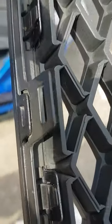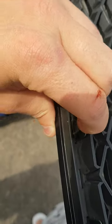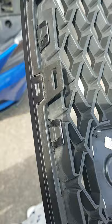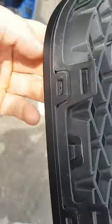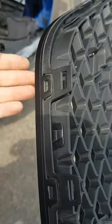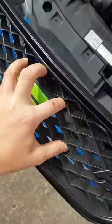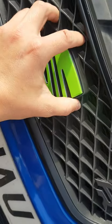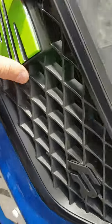For the inner clips, pull the plastic back and then push it forward and it should work its way out. I used two people to do this because the clips kept clipping back in. To put it back in, you just hold it up and push it in, working it in from the bottom and then they just clip back in.